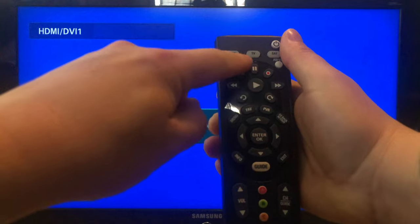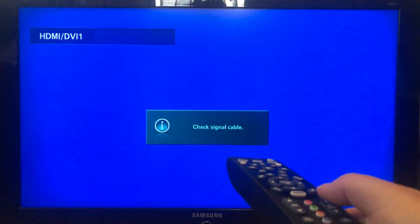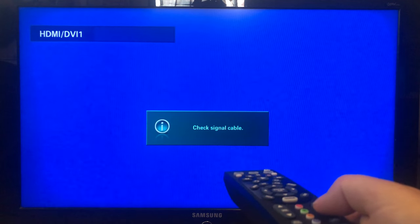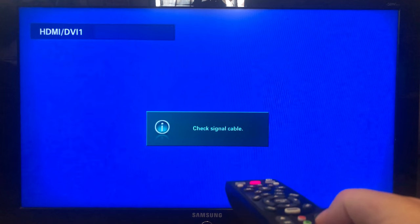You've seen up top how the TV light started to flash. Now just start turning your channel changer up or down until the TV shuts off. Go nice and slow, because if you go past it and then try to turn it back on, it won't work — you've gone past the code. It's a manual scan.